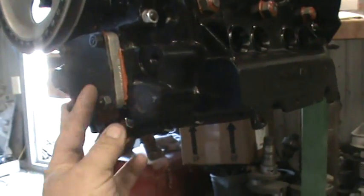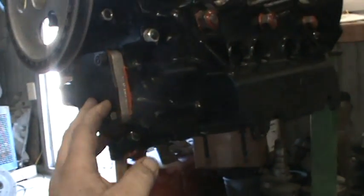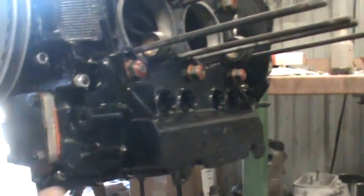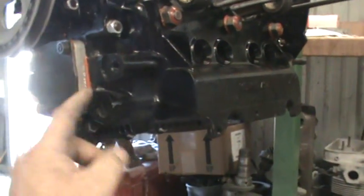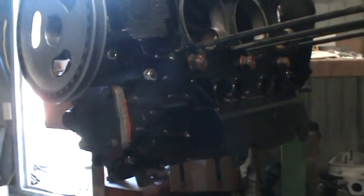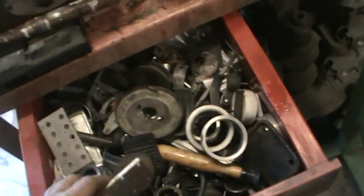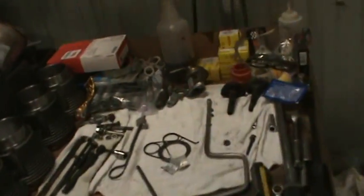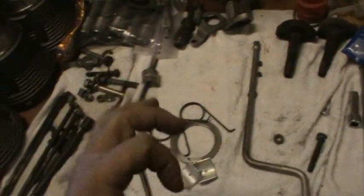The other thing that can cause drag is your oil pump assembly. A lot of times these pumps are sort of universal. You need to make sure you have the correct pump for the camshaft you're running — they have a dish cam and a flat cam, two different types. I always assemble the pump without the gasket into the case half, put my gear in there and make sure it's not protruding out of the pump so when you bolt the cover on it's not binding the gears. Sometimes you have to adjust the rod in the gear using a press — you can press the shaft through the gear and adjust the depth of the gear that way.